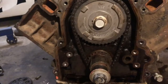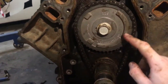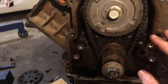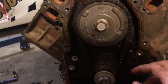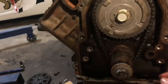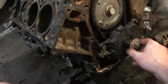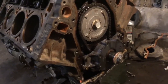From the front, what the new cam positioning sensor will actually read off of are these bumps right here. As I mentioned, I'm going to have to get a Gen 4 front cover and this should all work together. I'm going to tighten this down to 26 foot-pounds and then we should be good to install the oil pump. There you have it — the oil pump is installed, LS3 cam is in, and it wasn't too difficult.